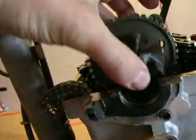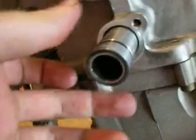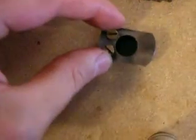Once you've got the chain off the gear, you can slip the camshaft through and remove it. Once you remove it, your cam chain is loose. You also have to pull a water jacket out of here — it's a sleeve that was in this hole. I grabbed it with a dental pick on the inside; there was a groove I could get a hold of and it popped free, not too bad. Down here you also have to remove your reed valve cover, which has two nuts. There's a little cover and a reed valve right here. Remove that cover so those nuts are out of your way — that gives you the clearance to drop the chain down.